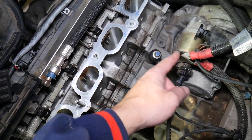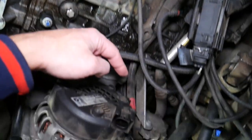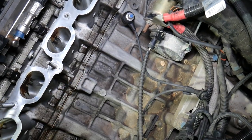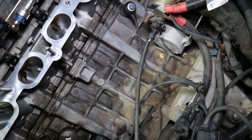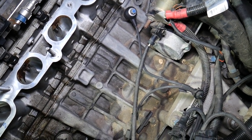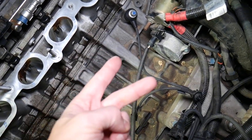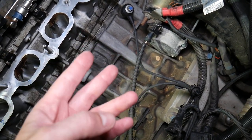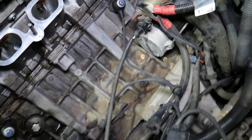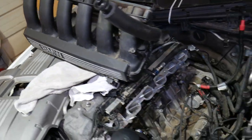When you remove the intake manifold and the knock sensors, you're very close to the positive wire coming from the car battery going to the engine starter and alternator. If you touch that wire with a tool, you can short things out, burn the engine computer modules, or even catch the car on fire. So disconnect the car battery first. If you don't know the correct way to disconnect the battery — which terminal to disconnect and reconnect first — we have a video explaining all that, linked in the description below. We also have a link to the video explaining how to remove the intake manifold.